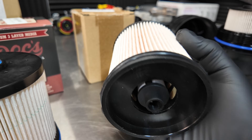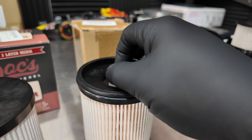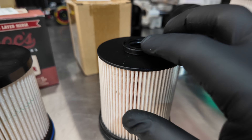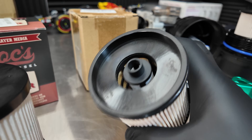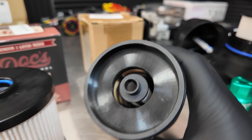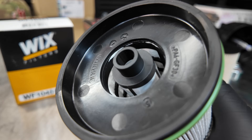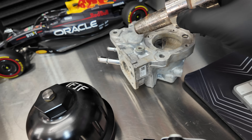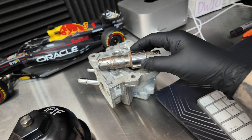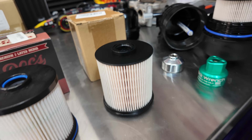And now we have the $10 fuel filter. I went on Amazon and tried to find the cheapest fuel filter to show you — this is scary. This right here is extremely loose. This is a critical component in filtering out the water. Remember how I told you how it filters the water through that screen? If that's loose, you're actually going to get water coming through there, which means there's really no water separation going on. Also, you look inside there and there's no mesh inside — so there's nothing attempting to grab the water like the other ones have. That is critical, because the last thing you want is water going into your fuel system. It goes into your injection pump, and it doesn't take much — there are such tight clearances inside these injection pumps that any water in there could cause major, major issues.